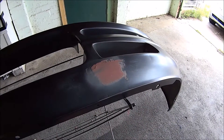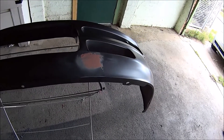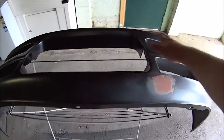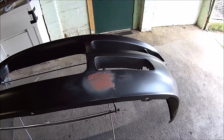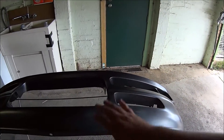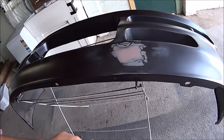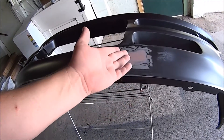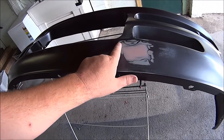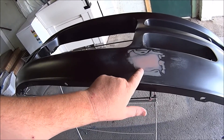So I'm putting some bog down and I hope I can leave a little bit of bog there, prime over it, and then finish painting — that's the plan. I don't know if it'll work. I'm pretty pissed off, I was pretty close to finishing this, and now I've got primer over spray everywhere too. I'm going to have to wet sand all that with some 2000 grit to make sure I get all the over spray off before I paint that area and give it all a general spray, then finally put the clear on it. I've filled the area where whatever it was. I do need a little bit more fine sanding just to make sure I don't have any raised edges here, but the primer will be going on shortly.